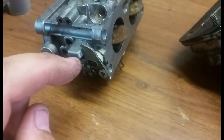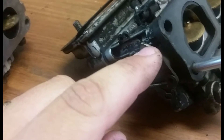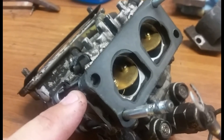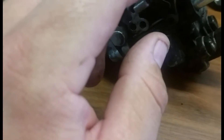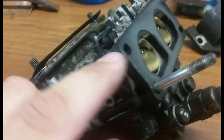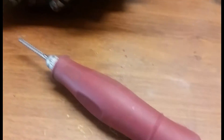There are a couple of ways you can go about this. The first option is to swap the throttle shaft from the 25 horsepower carburetor onto the 23, which would let it open all the way at full throttle. But what I'm going to do is do it for free — take a Dremel and do a little clearancing work, grinding back this throttle stop on the throttle shaft just enough to let it open all the way.